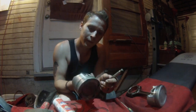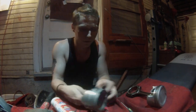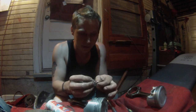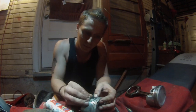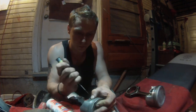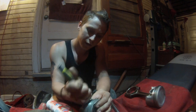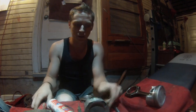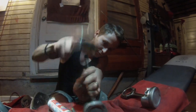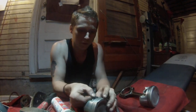There's a small groove for a snap ring. Before you get too far, go ahead and put your snap ring in. I don't have the snap ring tool right now, but I just use a screwdriver — it snaps right in. Now that you've got the snap ring in, you can finish driving the pin through to its limit, then put the other snap ring in on the other side.